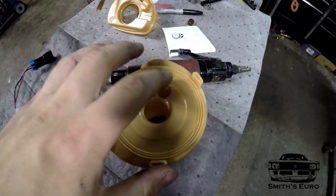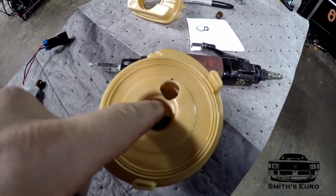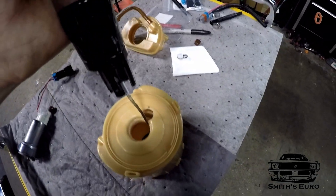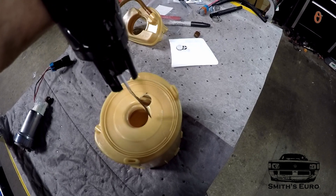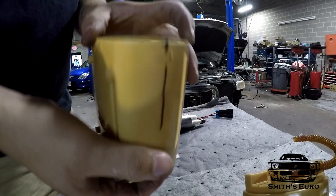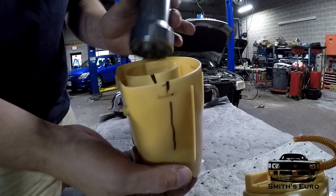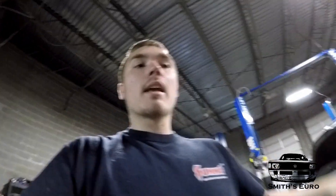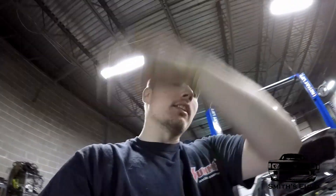It's pretty snug. I have the hole drilled and it works really good, but I need to get this raised edge out. Not everybody's going to have this, but I'm using a body saw to saw all the way around the hole. Now I'll drop the fuel pump in. The reason these are so good is that return fuel comes right back into here, so it's basically like making your own surge tank. That's really good for a Mark 1 tank since there's no baffling at all — everything pulled out goes right back in and stays contained, so you'll have better drivability when the tank's low.